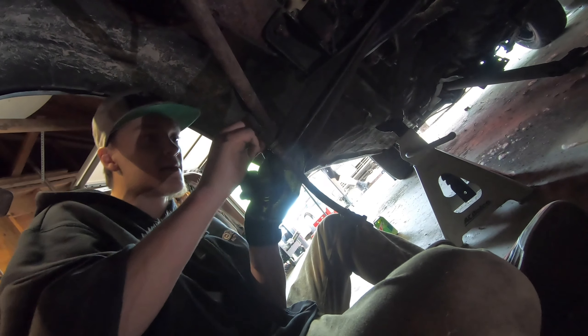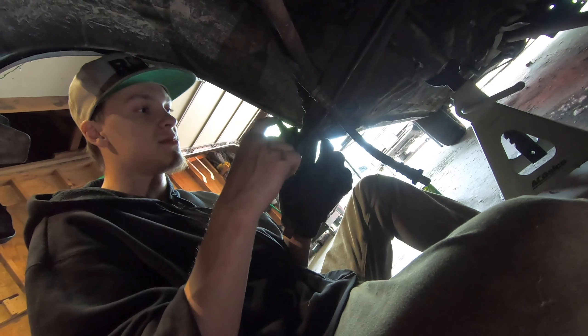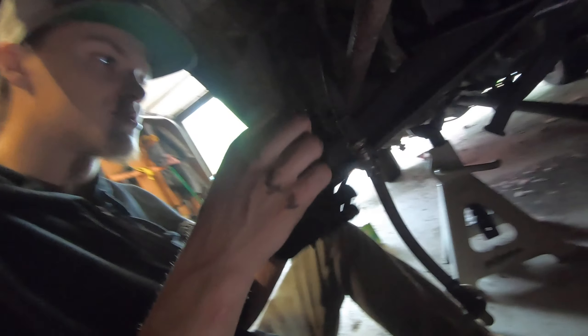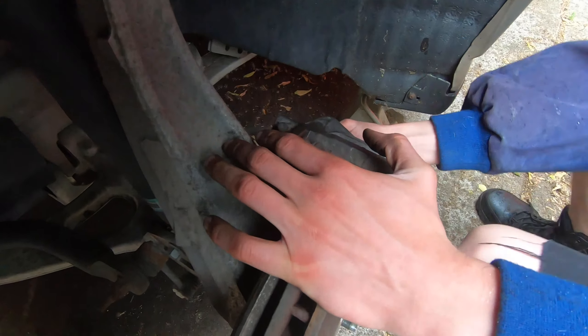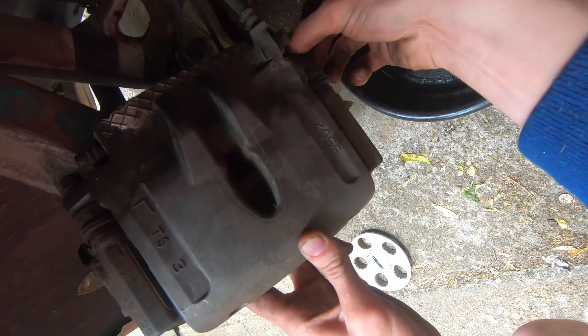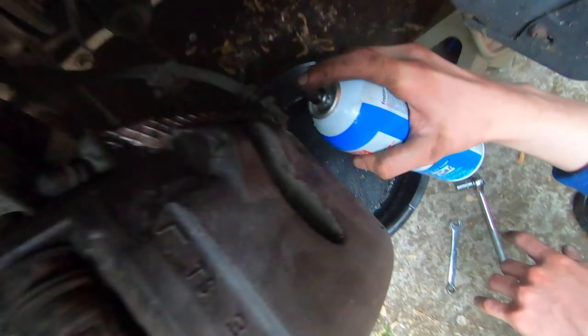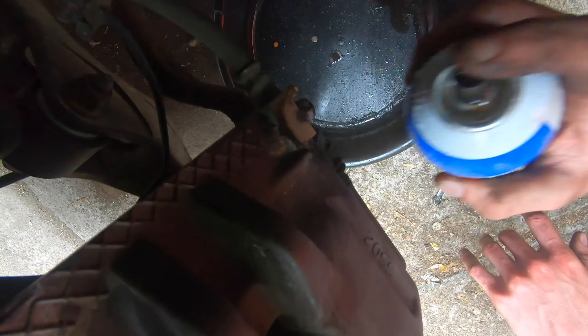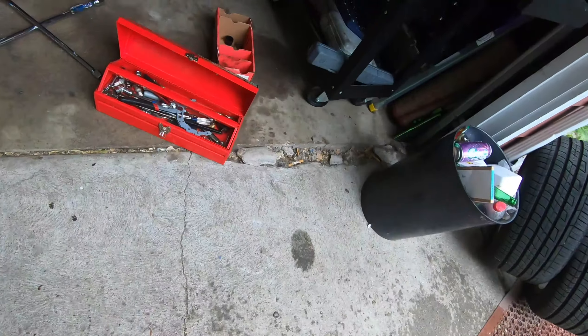I should hold the control arm nice and in place. Don't want to bolt these down too tight because I still got to get the strut in here — strut sits on top of this one. Right now I need to get this bleeder screw on the bottom here loose, and with this wobbling around I can't get much leverage. So I'm putting the pins back in and tightening them enough to hold the caliper in place to get more leverage and crack it loose. I'm going to find a 10mm socket in my unorganized assorted box of tools.